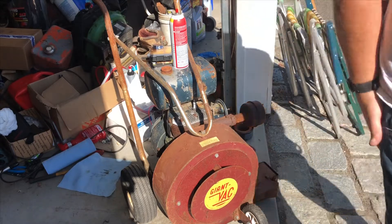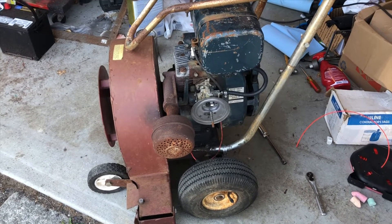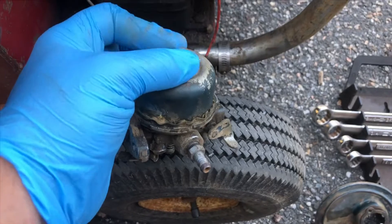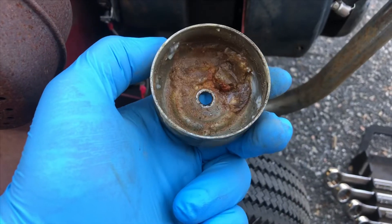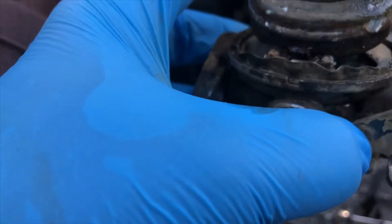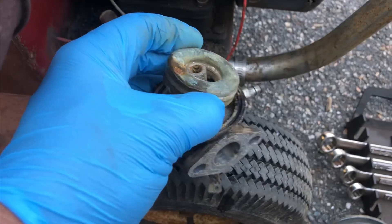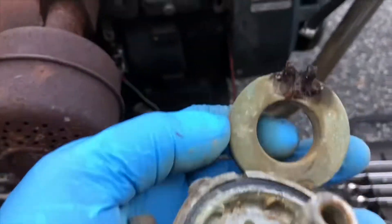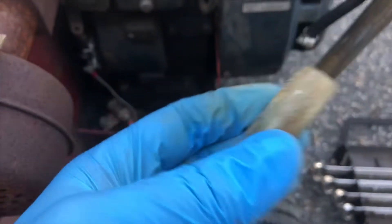Let's take this carb off this K-181 and clean it out, put it back together and see if we can get this sucker to fire up nice. Let's see what we got — got the carb off, take the bowl off. Oh yeah, look at that — holy ethanol dude, that is sick. The whole thing is gunked up just like I thought. The float is like rusted to the pin. I got the float pin out — look how nasty this thing is. This is like the worst carb I've ever seen. The float is all rotted out — it's crazy. The float has a hole in it, you hear that? Full of liquid.